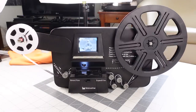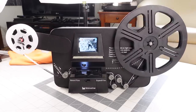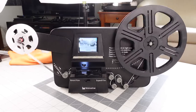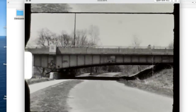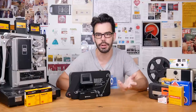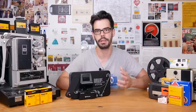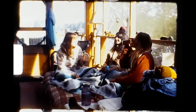The Wolverine moves pretty slowly, so it will take a long time to get through a lot of film. For this roll of Super 8, which is 50 feet of film, it took roughly 35 minutes to capture it. That amount of film is about 3.5 minutes long, so not a speedy transfer. Once you're done you can take the file off the SD card and there you have a digital copy of your film. The Wolverine gives you an MP4 video file with an H.264 codec, which ultimately just means it is a compressed video file.